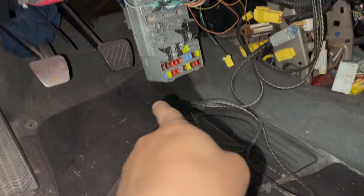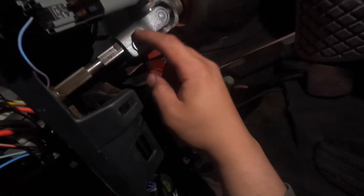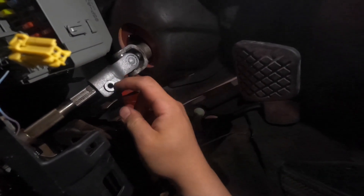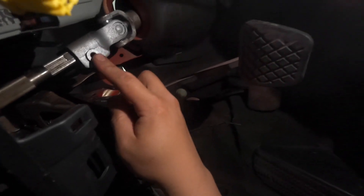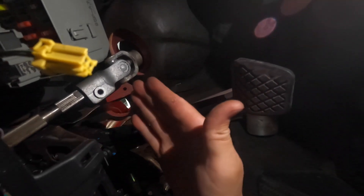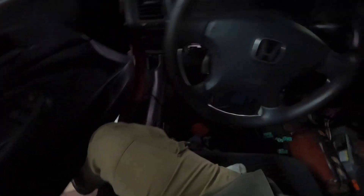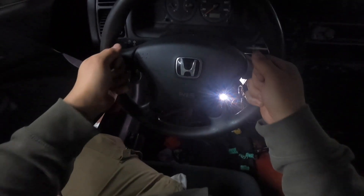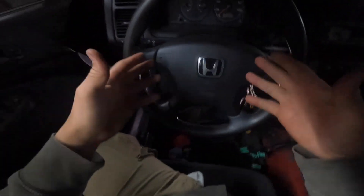So this is the inside of the car — it's just got a bunch of stuff inside, everything is in here. The fuse box is down because we had to remove the fuse box harness. You want to get this steering thing into this first, get that in there. You don't have to put the bolt in or anything yet because you might have to still adjust it. Also, when you're putting that in, try and have your steering wheel nice and straight so when you push it in everything is kind of lined up.